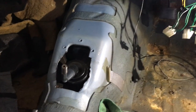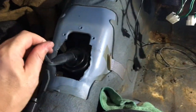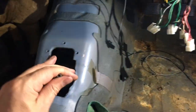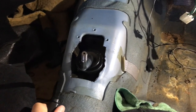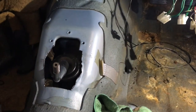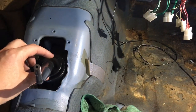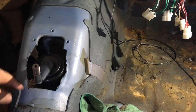Okay, so I've just bolted in the gear stick. There's only three 10mm screws under here. So now, 1, 2, 3, 4, 5, in reverse. So I've got a 5-speed gearbox all bolted off. I'm going to have to maybe trim this just a little bit more around here, just to tidy it up a bit. And then you can buy universal gaiters for gear sticks that will just screw onto the tunnel here and just screw through and maybe even pick up some of the existing holes.